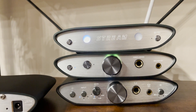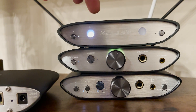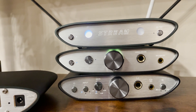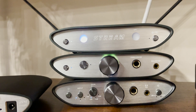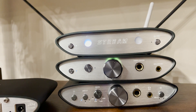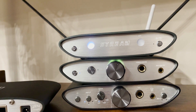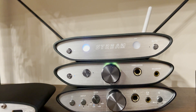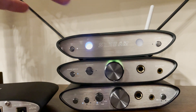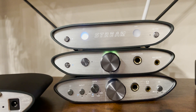This normally takes about 30 seconds to reconnect, and the light will now go white — that tells us we've got wireless and internet connectivity to the device. The colour of the LED indicates throughput and connectivity speed: white is what you're looking for, meaning strong and fast connection. If you get blue or green, you'll need to look at moving the device or adjusting your router's wireless broadcast signal. If you go the wired ethernet route, it'll go white by default as soon as it gets network connectivity — no setup mode needed whatsoever.